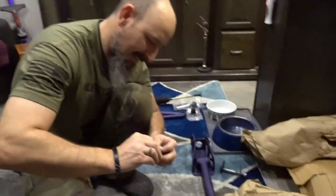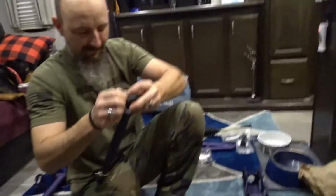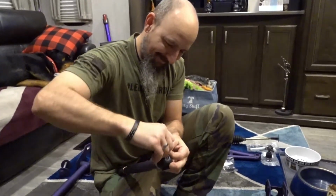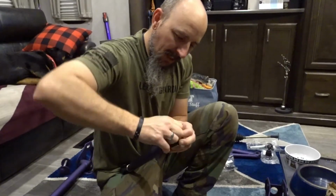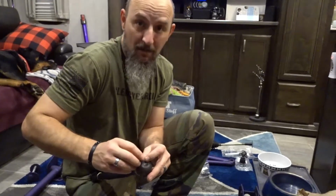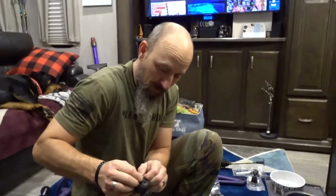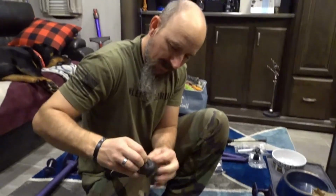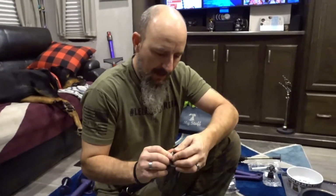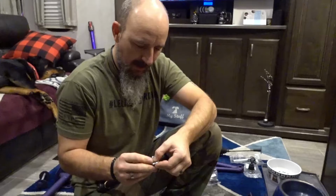Here, stiffer. Jesus, hold me back. Well, I'm gonna fight this for a minute. The fun joys of eliminating pillow ball bushings and going with heim joints. Yes, I know, if any of you know off-roading, yes, they're gonna be noisier. I already know this, it's solid metal to metal contact. We have small truck tires, it's already fucking noisy. Yeah, that we're not getting away from.